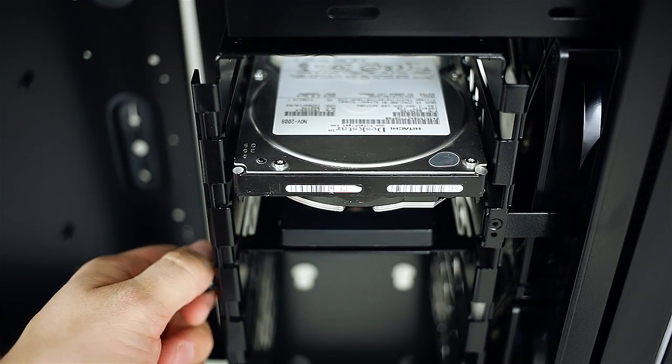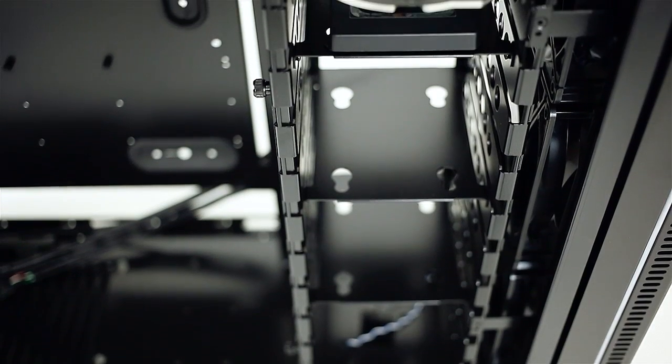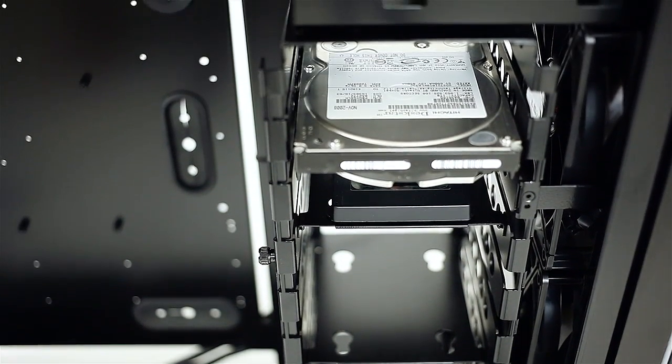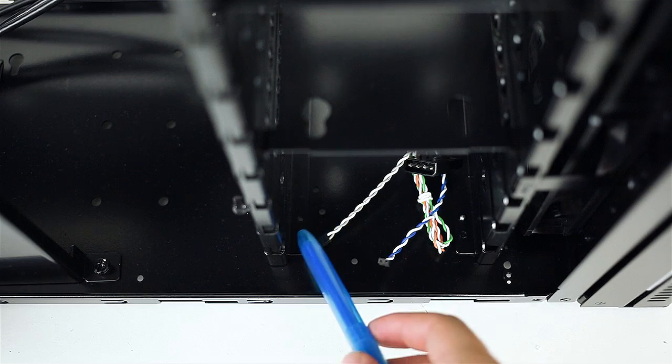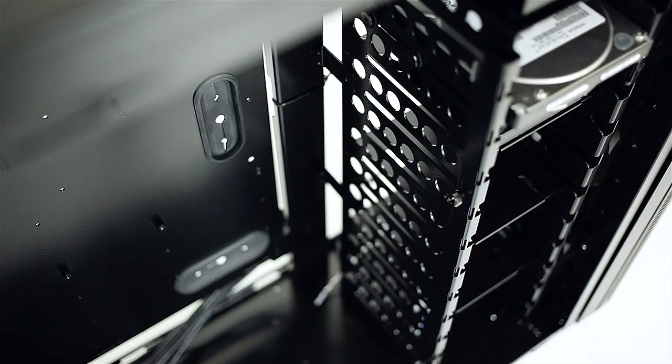However, the design of the cage is questionable for a few reasons. Well, first, it is not modular, so there's plenty of resistance on airflow even if you're only using a couple of drives. Second, the drive cage is not removable unless you take out your power tools. Third, there are no fan mounting options on the side, which holds great potential for that extra cooling.